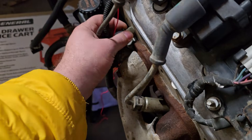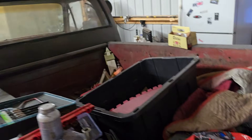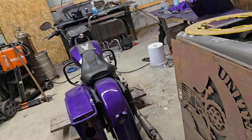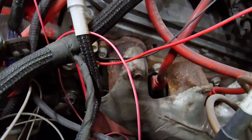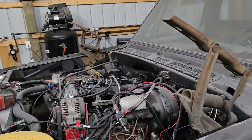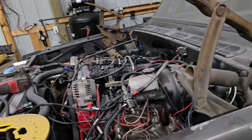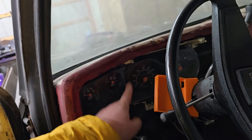On the side of the cylinder head is your coolant temp sensor. If you have a GM, you can do a cool trick and use an LS1 sender — a three-wire sending unit from a '99 Camaro. One wire will go to the PCM, because the LS does need to see the coolant temp sensor at the PCM, and the other wire goes to your gauge. So now we've got our temp and we've got our oil pressure taken care of.